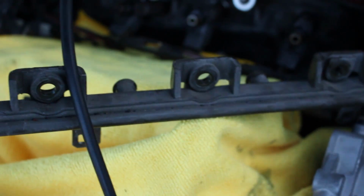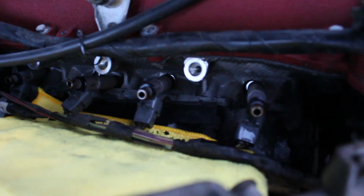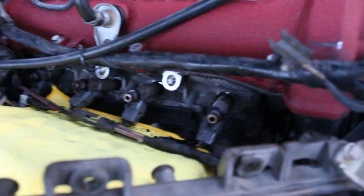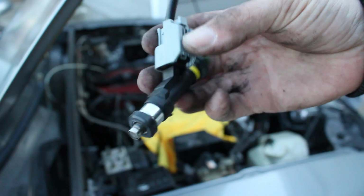You got 3 bolts to remove your fuel rail. That exposes the fuel injectors. There is a whole process to this, relieving the fuel pressure, etc. I do have a video on how to replace your fuel injectors, and I'll link that in the description as well. Out with the old Denso 270s, in with the new Bosch 440s.